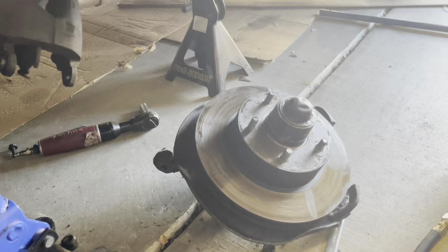The spring actually came up out of its seat on its own — I'm not too worried about getting killed now. I figured out why it's not coming out as easy: the bottom of the control arm is hitting my header. So I've got less room on this side than I did on the passenger side. I'm going to go get a spring compressor from the auto parts store and be safe.